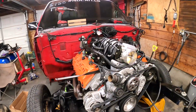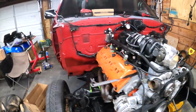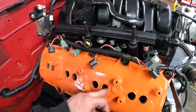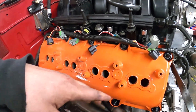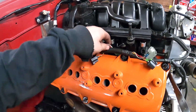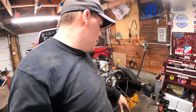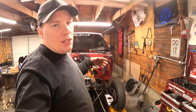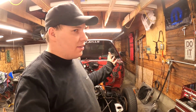Pull the phone out real quick. Pretty sure it's a little after 3. Yep, it's 3:08 a.m. I ran into a couple more snags here, but I got the belt, I got all accessories on, got all the connectors and clips done other than this side. So the Magnum, when I put the motor in it, this motor was down, so I robbed 4 coil packs off of this and put them in the Magnum. So firing it up tonight kind of went out the drain, unless I want to go take them off the Magnum. But that also posed another problem, is I want the O2 to read, so that way it idles normal, chops, etc. So I'm going to wait, I'm going to set up the exhaust side of the stuff tomorrow morning.